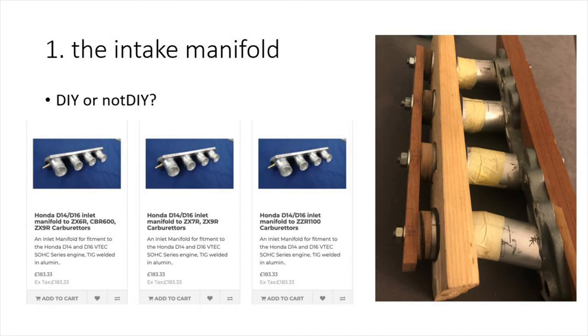I also found out there's a company in England called Dan ST Engineering that makes this stuff beautifully — and this is not sponsored by them, unfortunately. Not only can you find a flange plate there, you can find complete manifolds, joint hoses, vacuum bars, and even entire sets for this conversion. If you decide to buy a finished manifold, that's the place to go. But before buying, you have to know which carbs you're going to use, since they are all spaced differently.